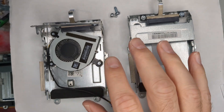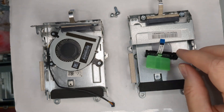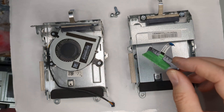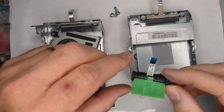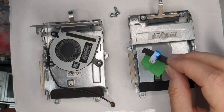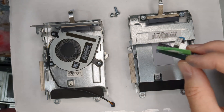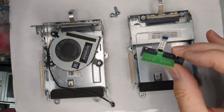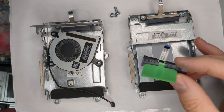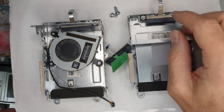I did some testing because the viewer asked whether these SATA connectors can be used on other units. I took a G2 connector and tried it on a G3 — it actually did work. It's a very short cable and doesn't have the screws so it won't be held in tightly onto your cage, but in a pinch you could try it. I would not recommend it as a regular practice since these were made for a particular unit, but it might be okay for a test scenario.